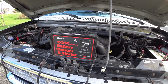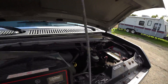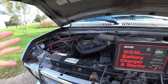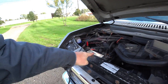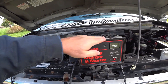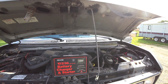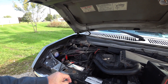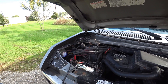Something pretty simple with this one, and then also complicated. As you can see, we got the battery charger on here. The thing is, the battery charger is not just charging this battery - it's also charging that battery over there because of this isolator relay that I installed, which works really well. But it's kind of an issue whenever you're trying to troubleshoot electrical problems. I decided to use my old Sears battery charger. We thought this battery might be a little bit low. As soon as I put the charger on and this battery saw the voltage it needed for those seconds, it turned on the isolator and it basically became jumper cables to connect the other battery, and the van started immediately.